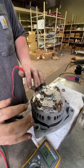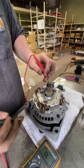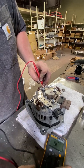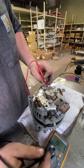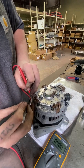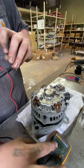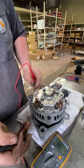The first thing you're going to do is test the negative diodes. You'll see that there are six soldered or welded connections, depending on the brand of unit you've got. Take your positive lead and put it somewhere on the case of the alternator, then check each individual diode. The main thing you're looking for is not to see OL and not to see all zeros — or on a continuity/diode test, not to hear a beep. You can see here we're between 0.3 and 0.6 on all the diodes. If the diodes are actually bad, you'll see a 0, which tells you there's a short internally from the diodes or the stator being shorted against the case or the lamination stack.